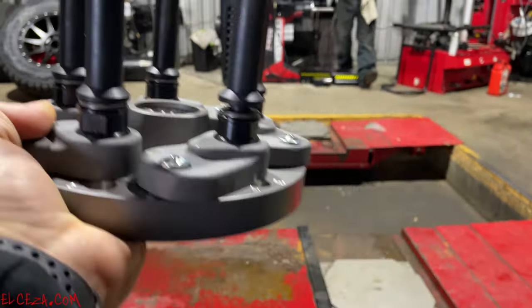Now, safety deal. If you forget that the wheel lift is up and you try to lower the hood and spin the tire, what's going to happen? It lowers automatically. The wheel lift's going to go down. It's got a sensor in it. It realizes you lowered the hood, and it says, whoa, lower the wheel lift. So it will not stay up. You don't have to worry about that, but using the wheel lift as a stop to help doesn't look good.